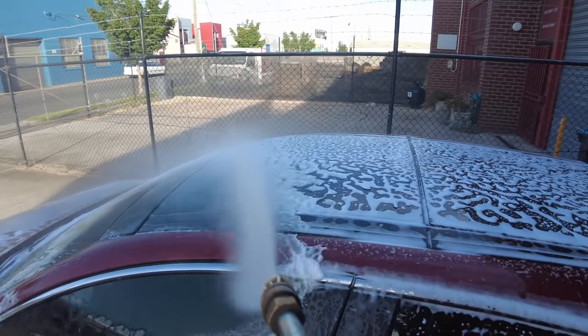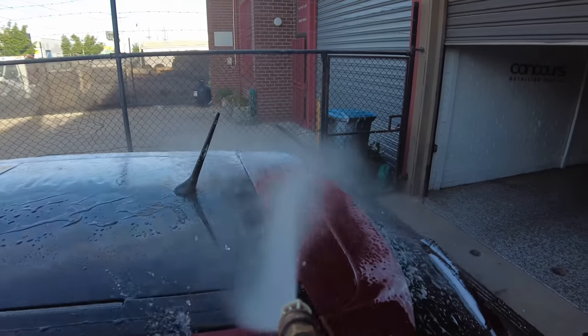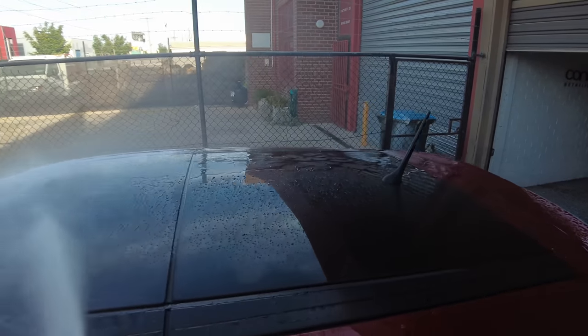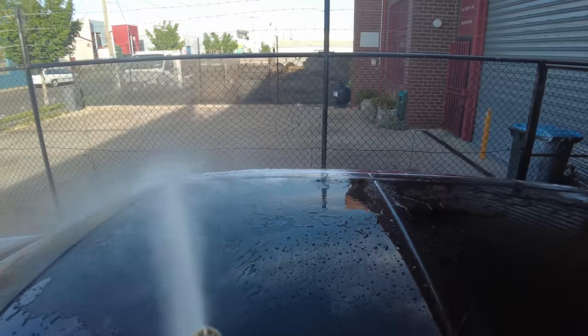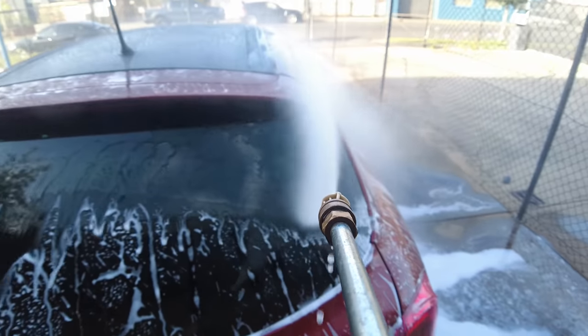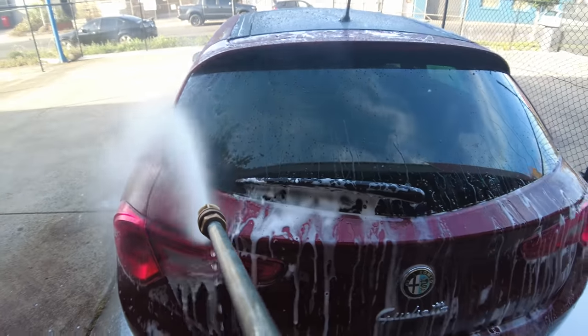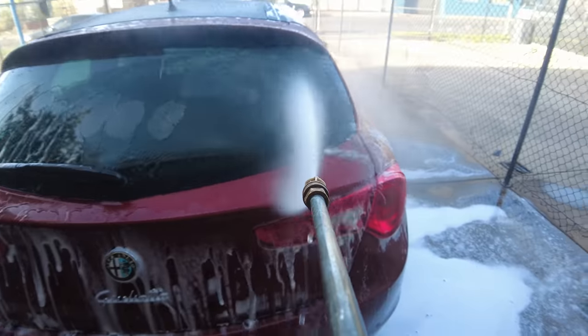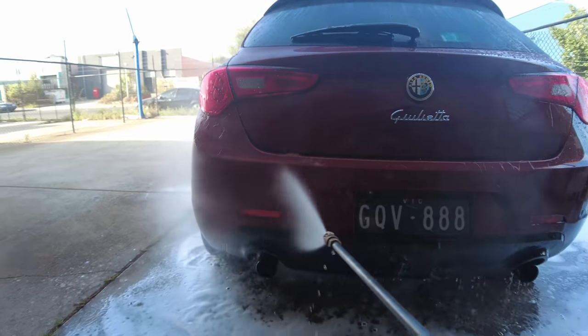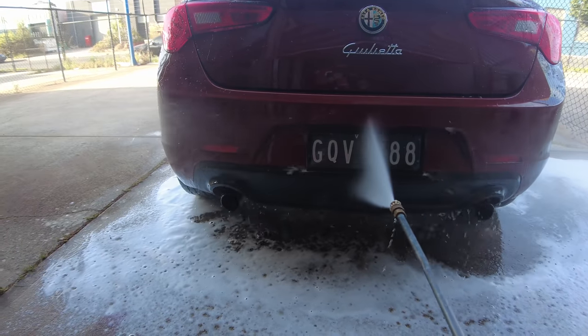The other thing I tested on a couple of cars was how it compares to a favourite decontamination pre-soak foam of mine, which is NV Snow Plus. I divided the cars in half and tried to use very consistent applications and methods and really observe the results after a good dwell and pressure rinse down. In the end, there just wasn't any conclusive evidence that one did particularly better than the other.